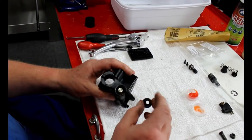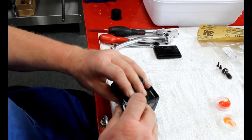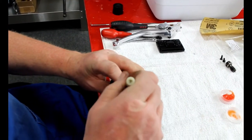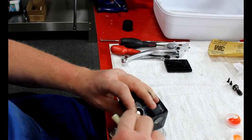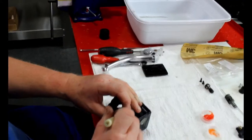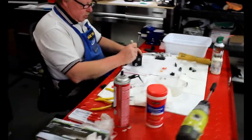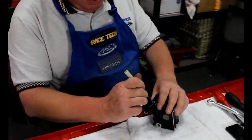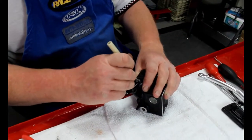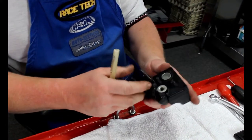So we're in there — now we've got to put our dust cap on. It has to fit into the groove right here. Sometimes you can get it started with your finger and just go around it and it'll drop in there. Other times it may be easier to give it a little help with the pocket screwdriver — and look at that, it went right in. Make sure it is squared. Once I've got it pushed into the groove, I need to push the bottom of it down into the unit to get my weather seal — so be gentle with this. I think I have a blunted screwdriver; I don't want to poke a hole in my new boot. Working the unit — moves smoothly, snaps back — all good there.